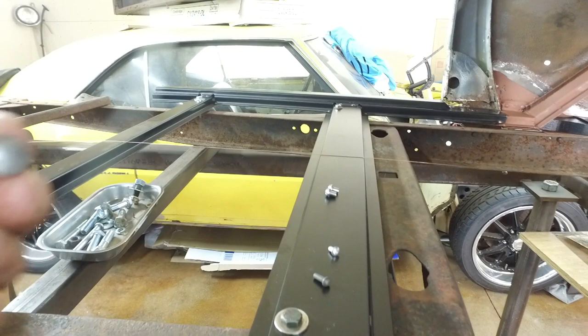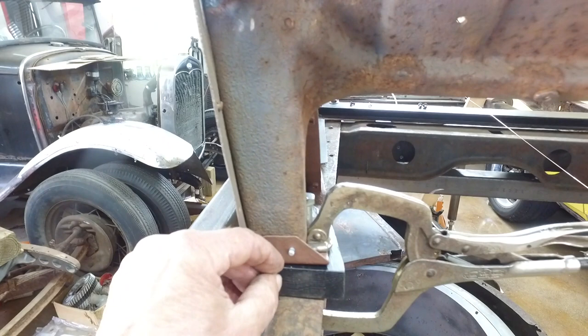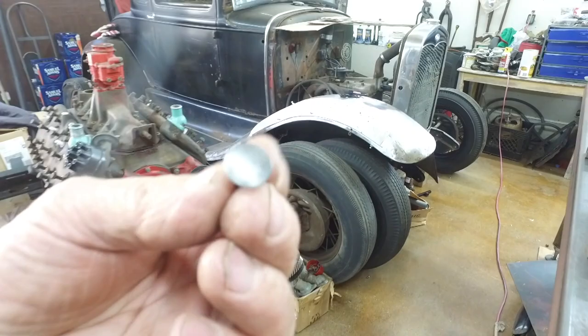It's not like a restoration. So I got some 7/32 rivets, and these are 7/32. So when I go to replace all these rivets, I'll drill these out to 7/32, and they're going to be nice and tight. So we'll drill out new. This is a 3/16 aluminum rivet. So the only problem is I got these truss head, and this head's not correct either.